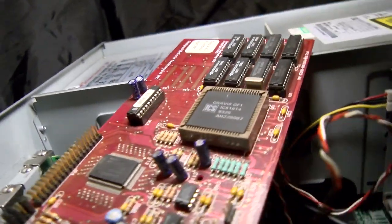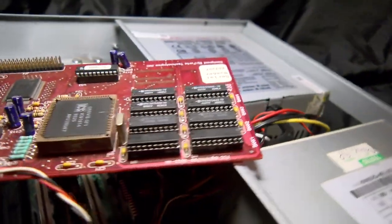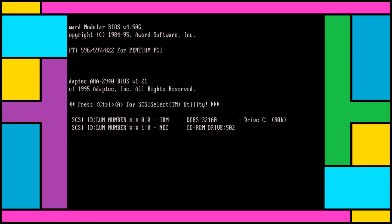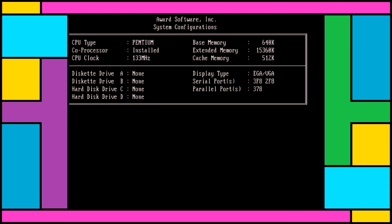The GUS claims to have Soundblaster Pro compatibility via software, and, well, that's a bit of a problem, because it is done in software, and that software is rather poor. There are two options at your disposal, SBOS and Mega-M. The latter can be forgotten about, because I've never known it to work. Typically it just crashes, does nothing, and, well, this should allow access to the MPU emulation as well, but I've never been able to get Mega-M to do anything much. So, like I said, forget about that.